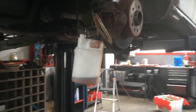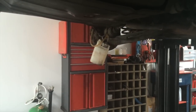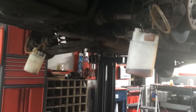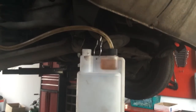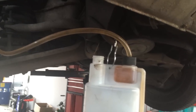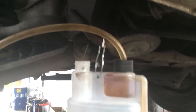Here's the way I use my brake fluid capture tanks. If you have two of them, you can hook them up to both rear wheels and really speed up the flushing process, particularly on an old car where you need to move a lot of fluid through it. We've got both of these hooked up and we're using the pressure bleeder up front. Notice the hook we supply with the capture tank — you can hang it from underneath the car and see the fluid moving into that small chamber as we use a wrench at the caliper to release brake fluid and watch it flow right into the capture tank. You'll be able to see when it starts running clean.